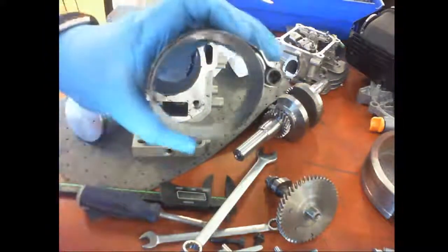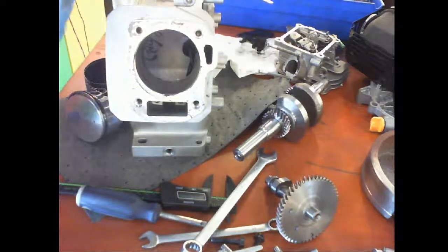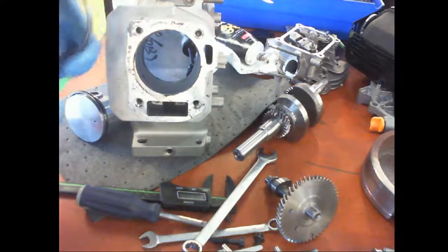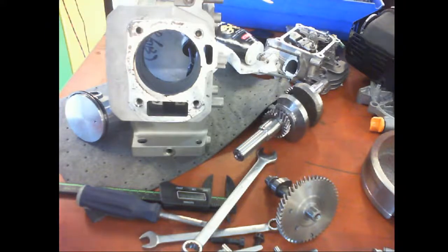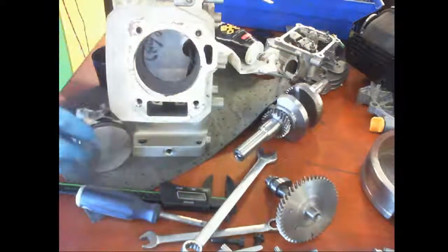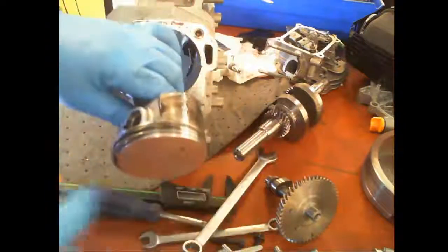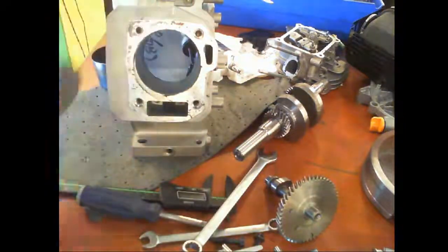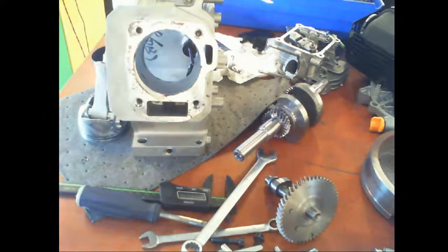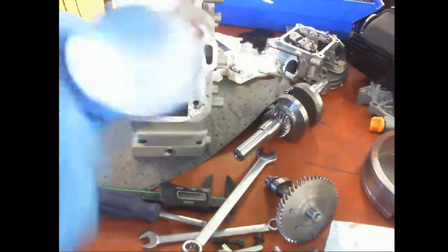Okay, next you're going to lube up the ring compressor. If the lube sits on there too long and it doesn't get broken down with motor oil, it gets sticky. And we don't want that. So I'm moving this around until it feels slippery on the hand. Okay, same thing on the piston skirts. Need some more. Okay. And then on this one, the piston, the arrow goes down.